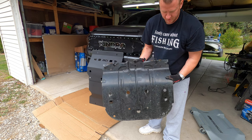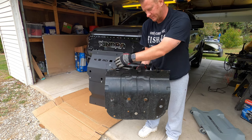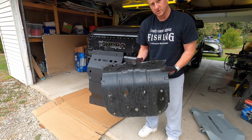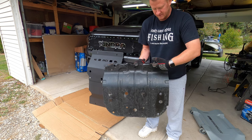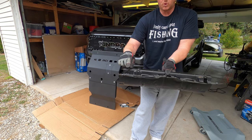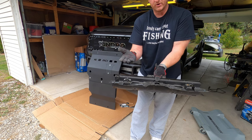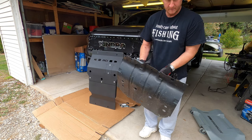The top two you can probably get at with a standard ratchet, but you'll need an extension for those bottom three. And then the other thing you'll need to do — there's going to be an upper section to your skid plate with three Phillips head screws that also have to be removed, and that's if you have the factory Toyota bumper and you never modified your skid plate. It does hook onto the bumper with two hooks. Once you have all the hardware removed — the three Phillips head screws and the five 12-millimeter bolts — all you have to do is lift the skid plate up a little bit and pop those hooks over the little lip. That's how you get the factory skid plate out. It's very simple.